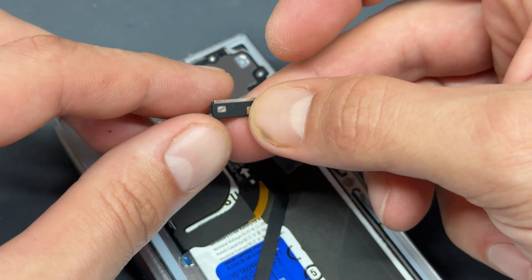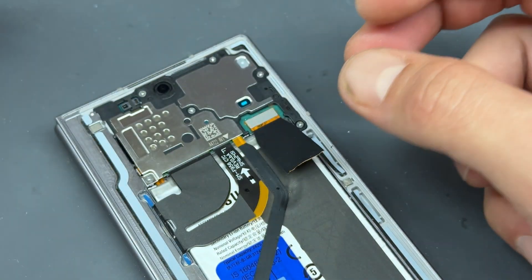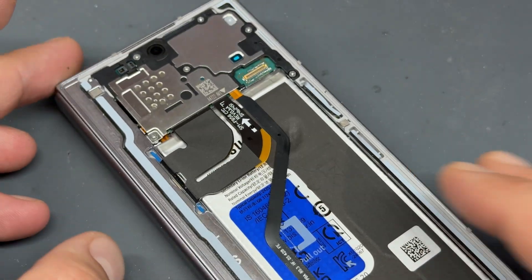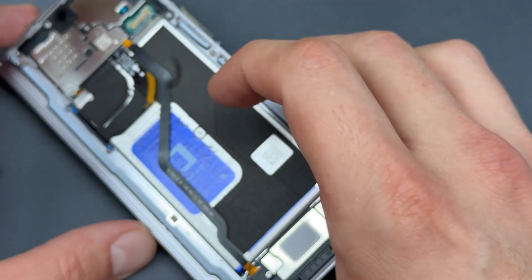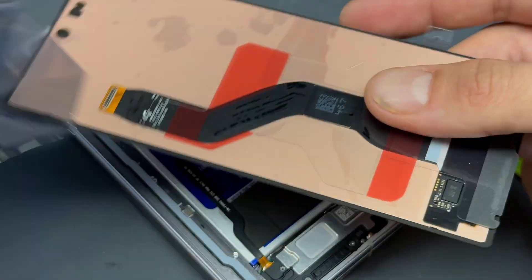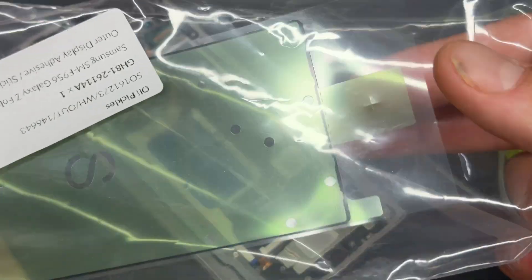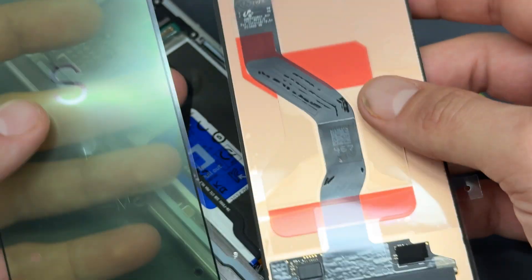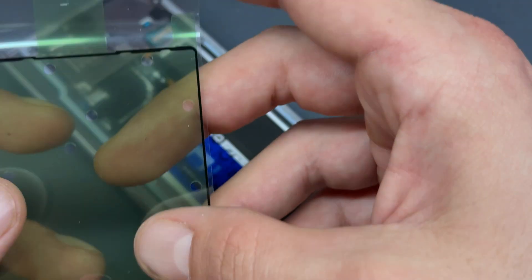What I can see here, it looks like there's a little plastic cover over this that you can just pop off. There is just a little plastic cover that pops off — it's just plastic and aluminium, a little shield. With that out of the way, we're going to pull that off, and that's the screen removed. The screen that we're using, as always, is a genuine Samsung service pack — I'll try and remember to leave a link in the description. Another really important factor is the adhesive on the screen, because these don't come with adhesive pre-applied, so it's always very important to get the genuine Samsung adhesive for your repair.